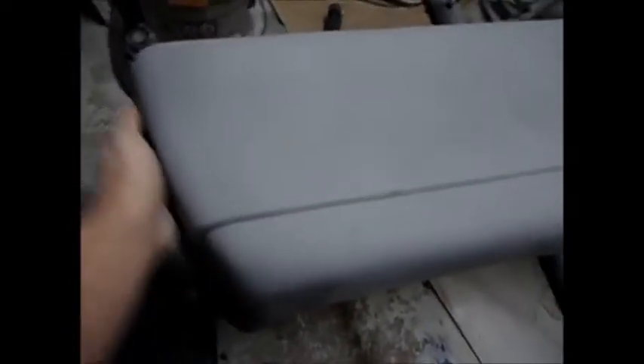Not so bad on the top side, but most people say, oh, well it's on the bottom, you're not going to see it. But you will see it. If you get low under the car and take pictures in the back, you're going to see a big lumpity lump right there. And I don't want a lumpy-looking rear bumper - the one that looks like it's rubber-made but it's actually fiberglass. So I might as well just fix it. Make it fit right. And even if I do fix this on my car and fit it perfectly, it doesn't guarantee it's going to fit the next car. That's just the way it goes - that's fiberglass, that's fitting bumpers and doors and stuff. It's just the name of the game. Everybody's going to have to fit it their own selves.